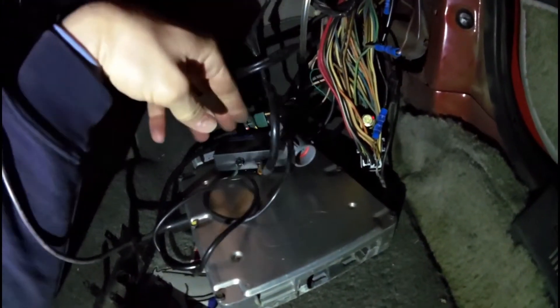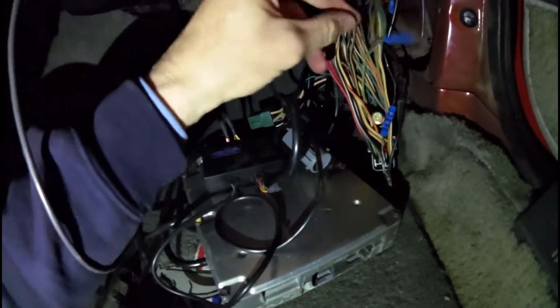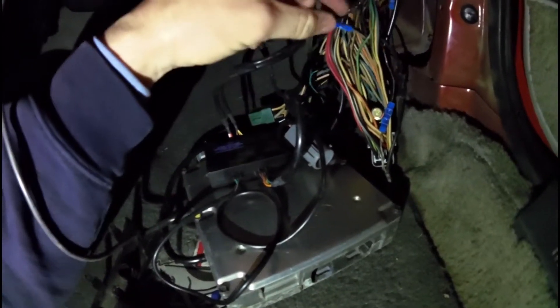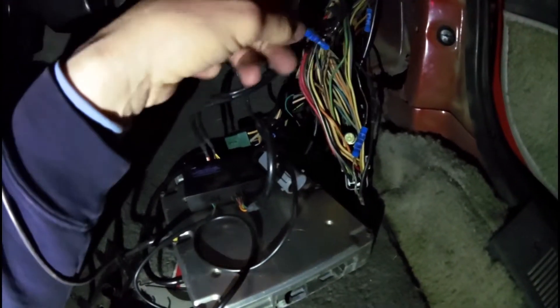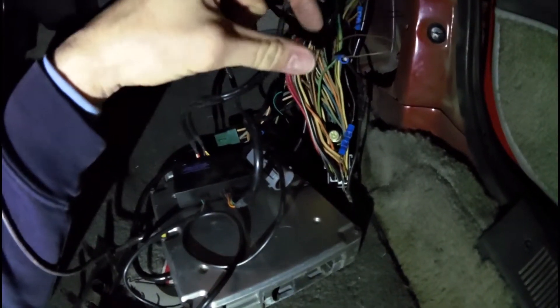You splice your analog signal coming from your wideband controller into it. All this does is bring in your analog signal, and you have to set it up — whether you want to do it in voltage or in current — so you'll have to look at that in the ECU setup when you get to that point. But here is where your physical connection is.